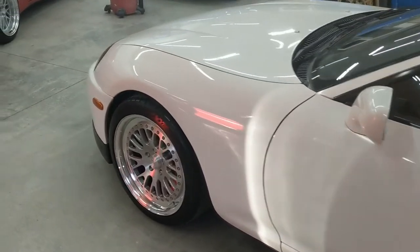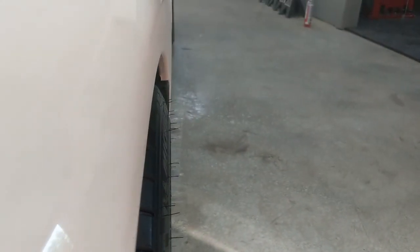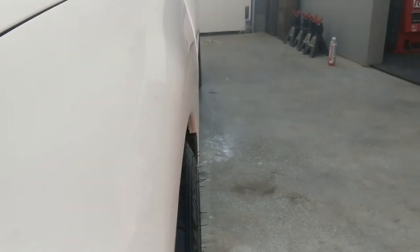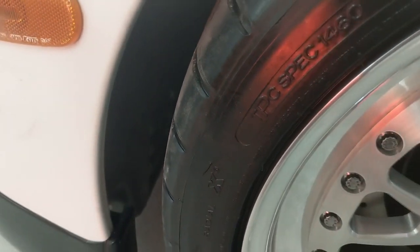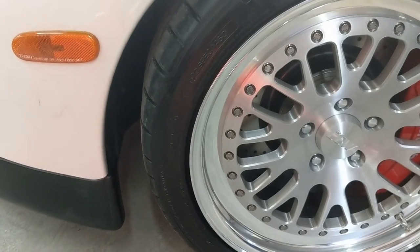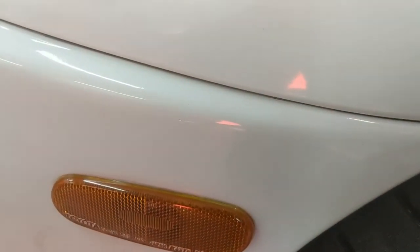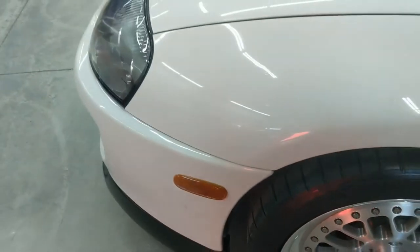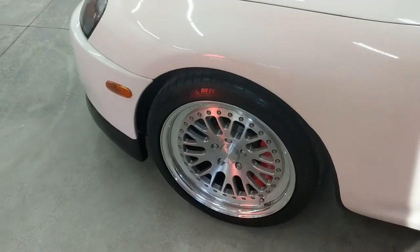The tires do stick out a tiny amount in the front, but the fronts tuck in when jacked up and at full lock they come very close to but don't rub the fender liner — probably as close as you can get without touching. The other side is even closer for some reason, and these are brand new fender liners. Not rubbing, so I'm not going to worry about it. I'll check what's rubbing over bumps after the alignment and ride height adjustment. The rears are tucked in some — the factory wheels tuck in quite a bit, but this 11-inch with 295/35/18 sits right at the edge of the quarter panel. If you had wider tires or were lower it would probably rub, but not much of a roll would fix that.